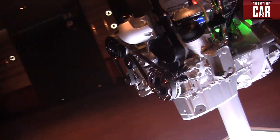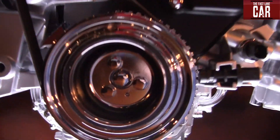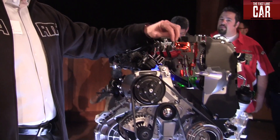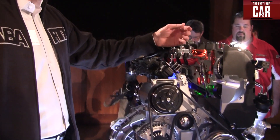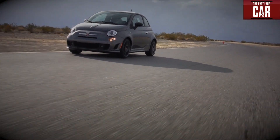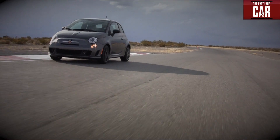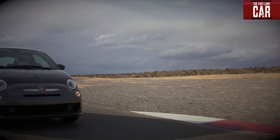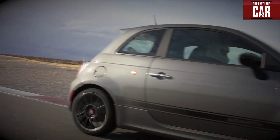We have a single exhaust cam with two lobes for two exhaust valves and one intake lobe. A roller finger follower follows that and runs the pump. The pump creates over 100 bar pressure in a high pressure chamber, and a very high response electronic solenoid simply opens and closes the passageway to feed oil to the two intake valves. It uses a collapsible hydraulic lash adjuster — when pumped up, you follow whatever part of the cam lobe you're on, and when we bleed it off, it closes rapidly.